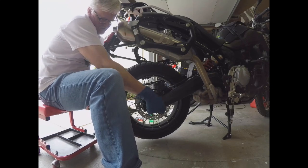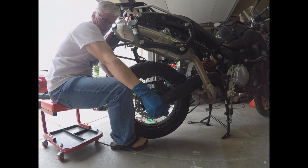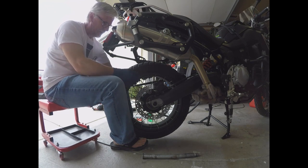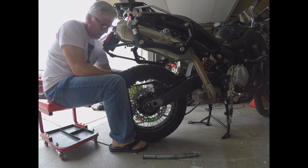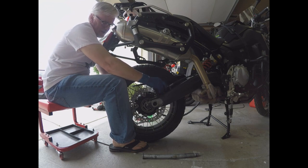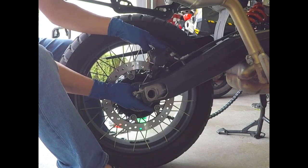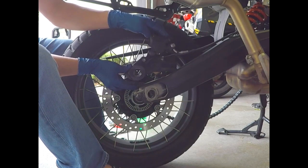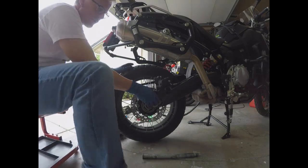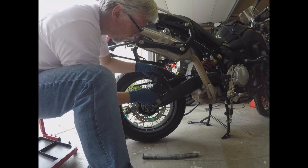Big axle out — holding the tire weight. There's the axle, it is a monster. That came off. Now, I don't know why this wasn't obvious the first time I did it, but it seems obvious now. There's a slot down here where my finger's pointing — this slot, it has to come out of that slot. There's a male portion there that it sits in, so that's important. The service manual probably says don't let the calipers dangle by their weight here, so I'm going to try to be good there.